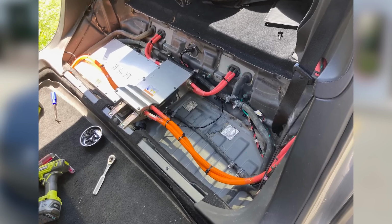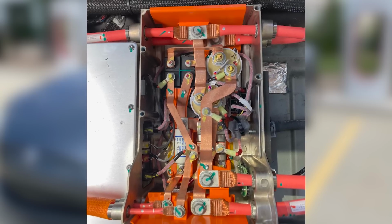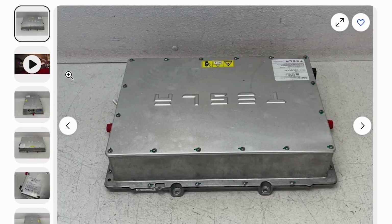I took apart the junction box. I took a look at the contactors in there that actually connect from the supercharger to the battery. Those worked fine. The only thing that I couldn't really check was the AC battery charger itself, but it seemed that that was the likely culprit. And because the first generation battery chargers really weren't that expensive, I just ordered one off of eBay.